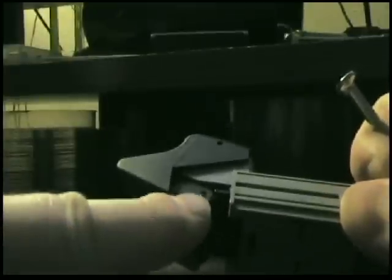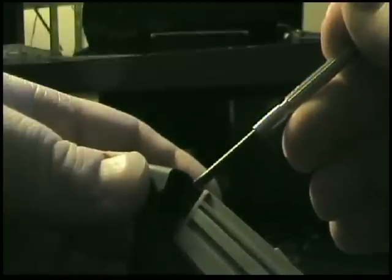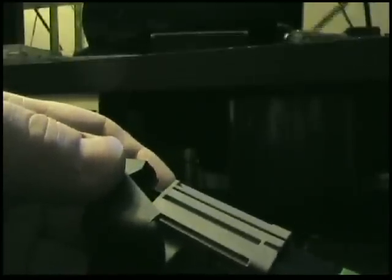I've already done one of these so it's not going to be like I can go back and make it cloudy again. Anyway, I got a switch here — pull them out of your gauge cluster. We're going to actually take the front of the switch off. What you want to look for are all these little tabs: there's one there, there's one up here, there's one down there, there's another one hidden up here.